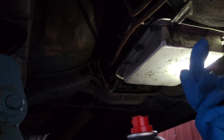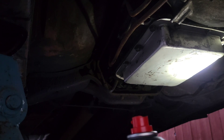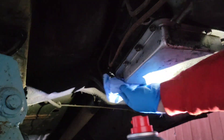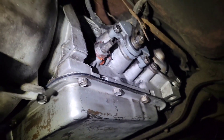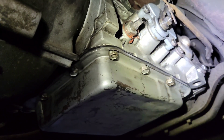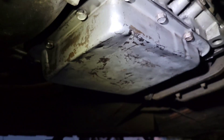I think that should be good — I don't want to keep going. The gasket looks nice and seated. I kind of cleaned it up around the neutral safety switch right there — I wiped it down because there was a big old leak. Now that I've wiped it down, I'll have a better idea if it starts leaking again whether it's not coming from the pan. I know it was from the pan before because the bolts weren't even tight, so I've never messed with it.